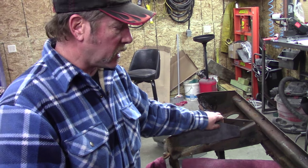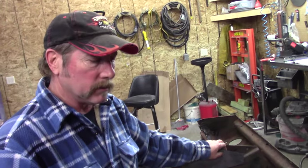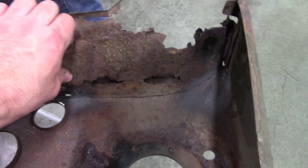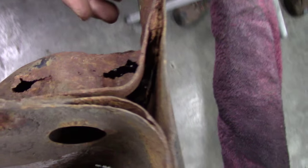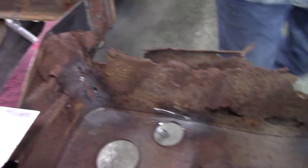This is going to be a lot of work rebuilding these two areas. The way this guy had it set up, the fenders didn't fit firm and things rattled around. Once we get these all sitting on brand new cushions and he's relocated this whole area, the thing's going to fit like a new car. We've reinforced the radiator surround. We're going to work on the battery tray and this mounting point for the core support. We're going to cut along the bottom here and replace that whole piece — it has to be bent up. I'm going to take a spot weld remover and try to get this out cleanly. The whole under piece is going to have to be replaced as well.